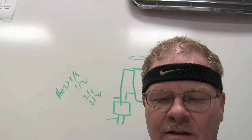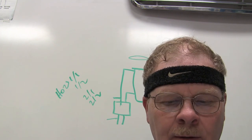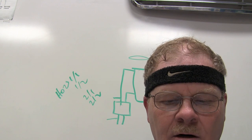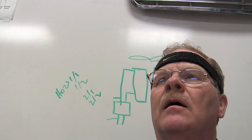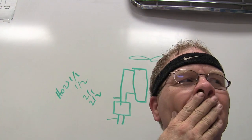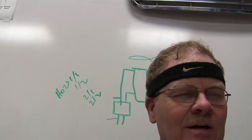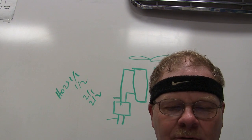When the concentration of oxygen on the exhaust side of the thimble is low, a voltage of about one volt is generated between the electrodes on the sensors we're used to. A large amount of oxygen in the exhaust causes the oxygen sensor to produce a low voltage. Who was that working on the white F-150 that had a rusted bolt letting the exhaust drop down? There was a big space between the header pipe and the manifold right above the oxygen sensor — it was causing the fuel trims on that side to be high because oxygen was getting in there that wasn't supposed to be, confusing the sensor.